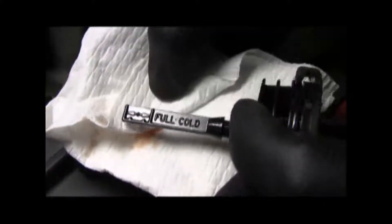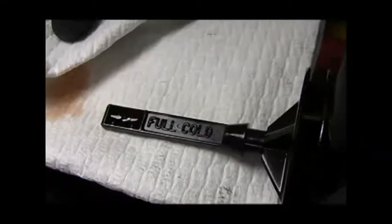Now we're moving on to the power steering fluid. The engine is cold right now, so we'll reach down and take the power steering cap off. We'll check for color — that color is nice and bright, that looks good. Note that your dipstick has a hot side and a cold side, so right now we're looking at the cold side. Go ahead and replace the dipstick, get a reading, then pull it out. We're in a normal range, right at the full side — that's perfect.